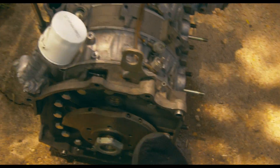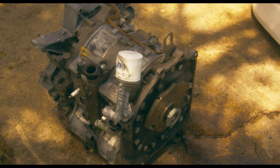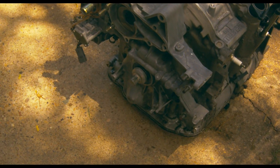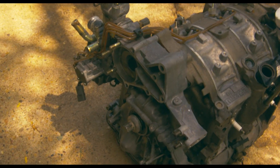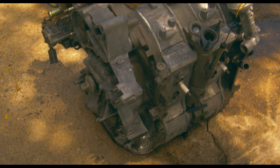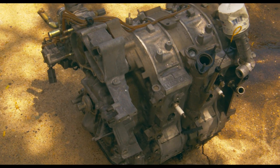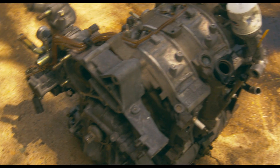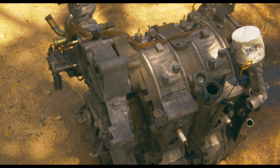On top of it being a four-port, it is also automatic — you can tell because it's got that rear counterweight right there. Shoutout to the actual owner who helped me get both the flywheel nut off and the front e-shaft nut. That one is normally torqued down to about 90 foot-pounds, and it defeated an air impact, defeated an electric impact — we ended up having to use a breaker bar strapping the engine to a minivan wheel.